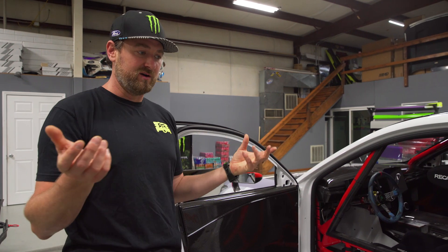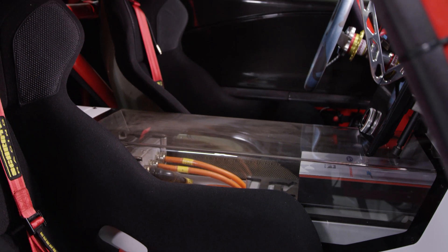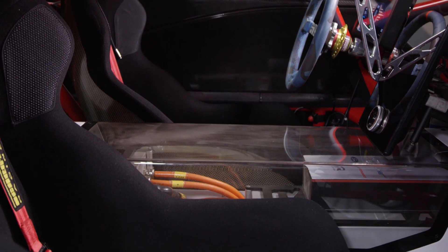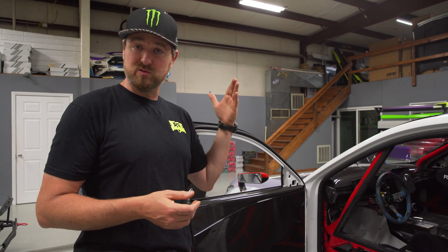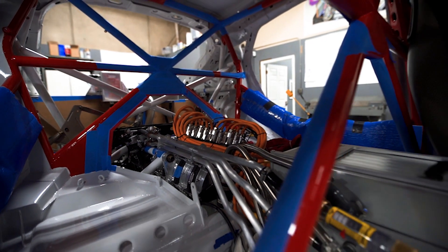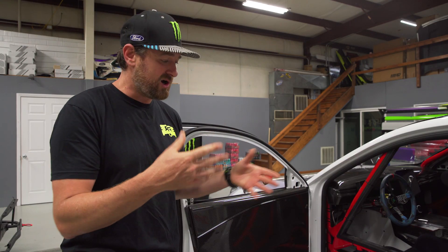The other thing that really pops out — when you pop the hood of an ICE engine you see the engine and all the wires, well this obviously doesn't have that in the front area. But when you get into the interior you see this beautiful plexiglass piece we made that is showing off the inverters — three in the front, four in the back. Those effectively control all of the power going out to the motors. They're directly connected to the 56 kilowatt hour, 700 volt battery in this vehicle. There's also a DC-to-DC converter which takes those 700 volts and converts them to 12 volts to run all the 12-volt systems — the fans, the MoTeC, all the lighting — all running off the main battery through that DC-to-DC converter.